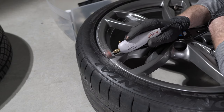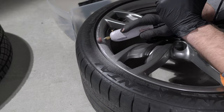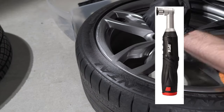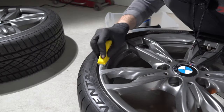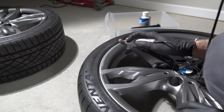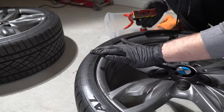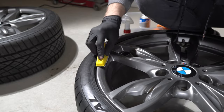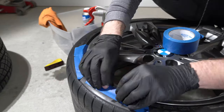The next stage of preparation is sanding. I used a multi-tool as the fastest way to grind unwanted material or damaged areas, though it's not that precise. Ideally, a rotary machine with a 1–2 inch sanding pad gives the best and fastest result. A cheaper method is just sandpaper and a piece of wood. I started with 400 grit on messed-up areas and 800 on touch-ups. After removing damaged areas, smooth the edges — even the slightest angle will be visible after painting. I did all shaping with 800 grit and a hand block, then moved to 1500, and used 2000 grit to scratch the clear coat area. Make sure there are no deep scratches and the surface is flat to the touch.